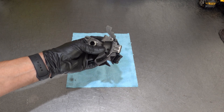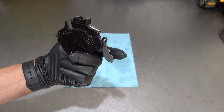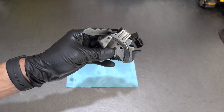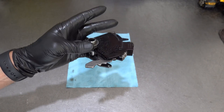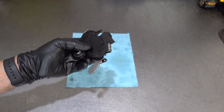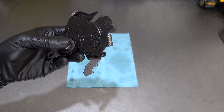This is the back side of the internal mode switch. It comes as an integrated rooster comb and sensor assembly. Anytime you overhaul a 2009 through 2014 model year 4L60E, you always replace this with a genuine GM part equivalent. Never buy an aftermarket sensor switch.